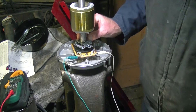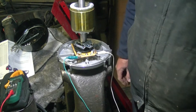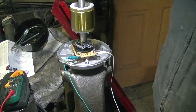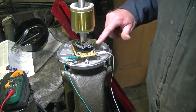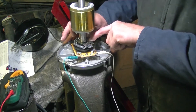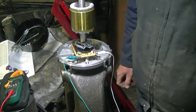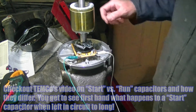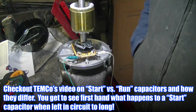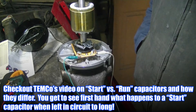The contacts are closed by default before you start the motor up. You can check for continuity across the capacitor leads, and you should have continuity when the motor is off. If you don't have that when it's off, then you've got a problem. The run capacitors are 100% duty cycle, which is why they're in a metal can with oil, and they'll also be at a lower farad rating than the start capacitors.